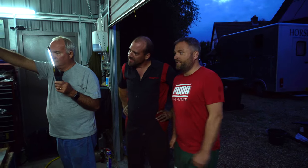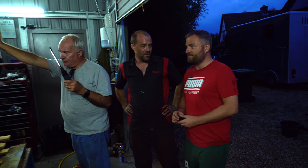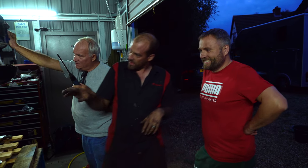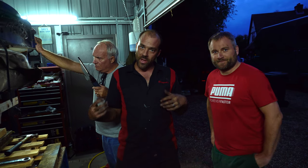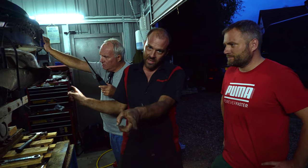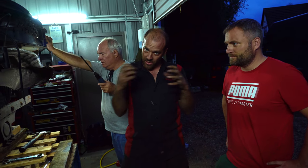We've dropped the engine and the transmission connected. Correct. Because we didn't have a crossover to hold it from the top. I think we're better. But the one bitch about this job is there is a fuel line. Because we don't have a Freon machine to recover the R134A out of it, we have to leave the compressor connected. Well, on this engine, for some reason, there are no line disconnects for the left or right fuel rail. They have to stay connected because they're crimped.